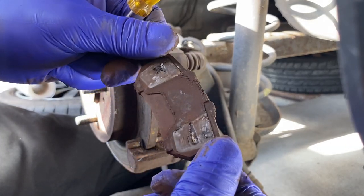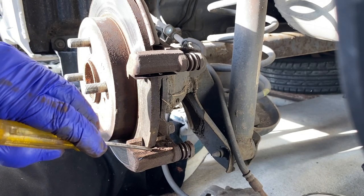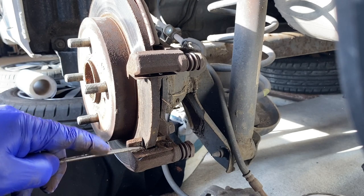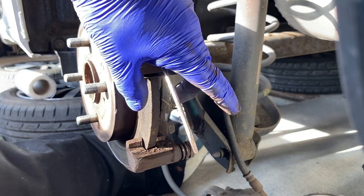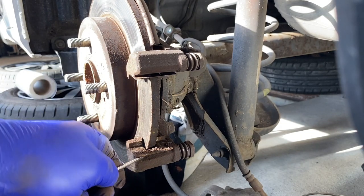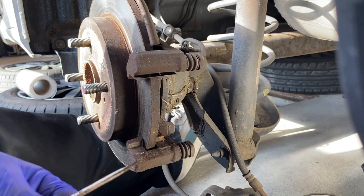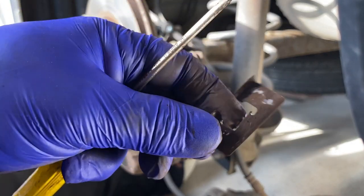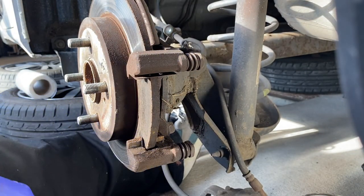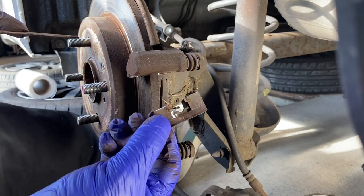There's the outer pad. What we've also got is a stainless steel rubbing plate that the pads ride on — they ride in and out on this plate, and the same up the top. When the brakes are applied they squeeze and the pads move on this, so we want this all cleaned up. It just prizes out — it's only a spring stainless steel guide. We're going to wire brush and clean them, and also wire brush the brake hanger. So we take the top one off as well; they just clip in.